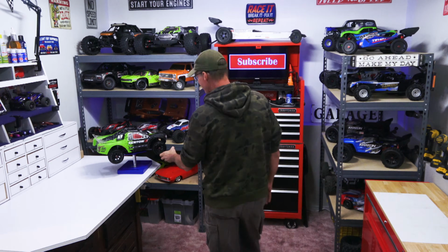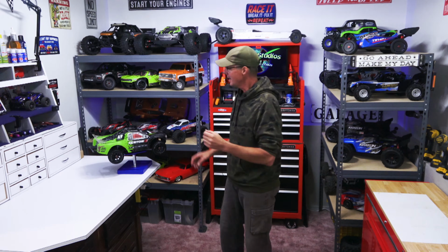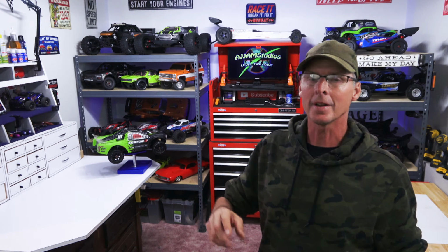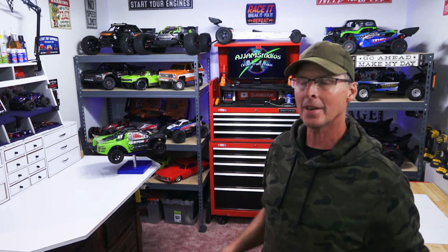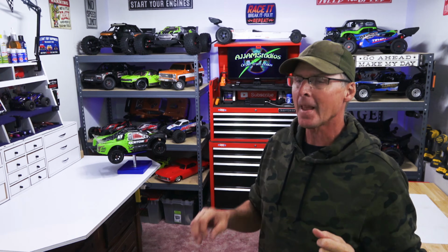Even with the tires, this has the 6-pack tires from Durtrax on it, and they work really well up to 4S. When you start going to 6S, we took those off and we put the TLR tires on it from the Typhon, which are the pin track tires. Those hold up to the 6S rating real well, and it handled good.